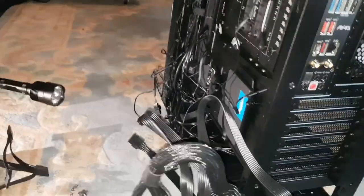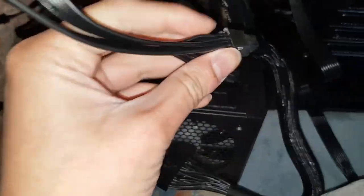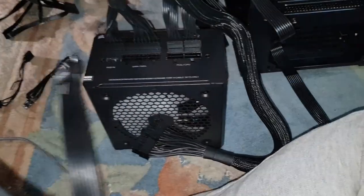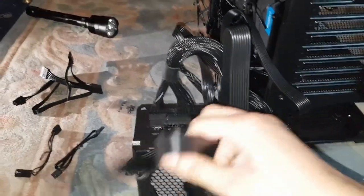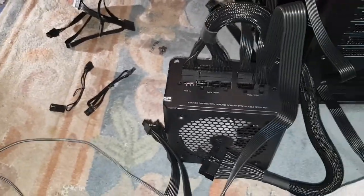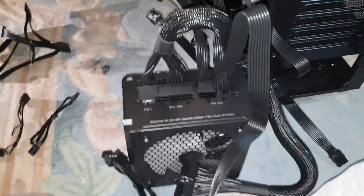Now, because we are going to install a graphics card one day, we need to put the PCIe cable in now. Otherwise you'd have to take the full power supply out again just to add the wire. The side with the label goes on the GPU — the unlabeled side goes into the power supply. We're only going to plug in one PCIe connector. Usually one is enough unless you're using a very powerful card like a 3090 or above. This is a 750-watt supply, so one port should be enough for now.